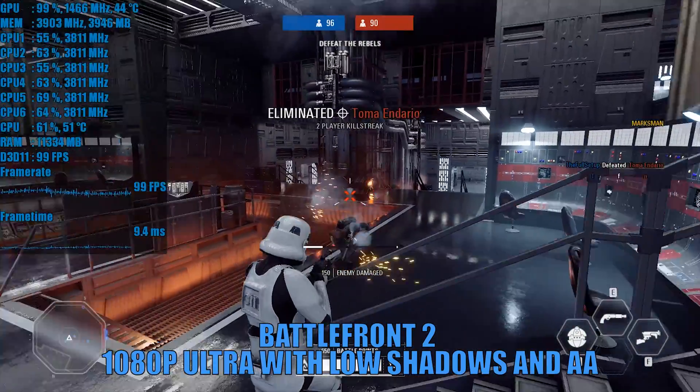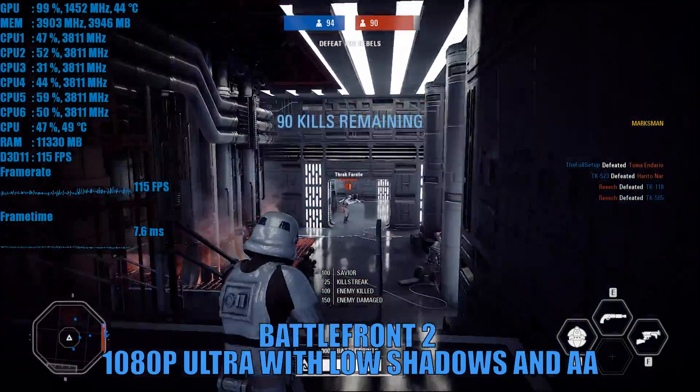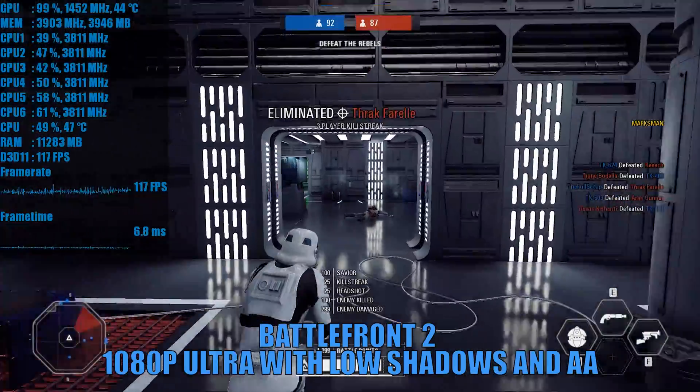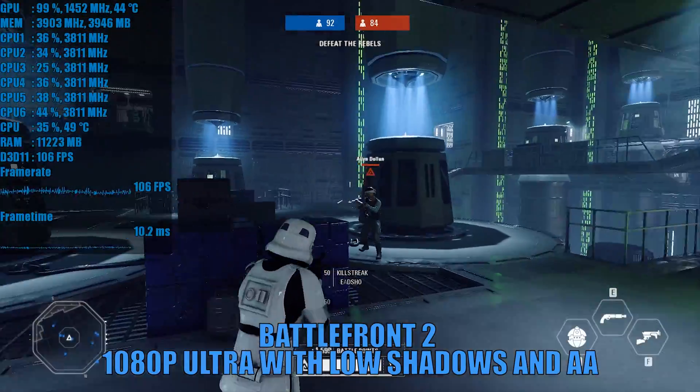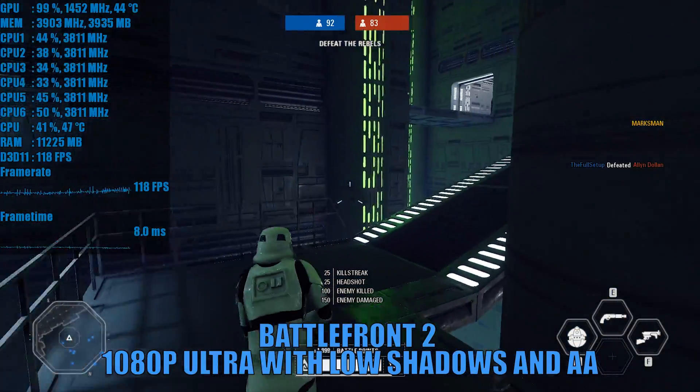There was something I ran into straight away: the EK Thermosphere doesn't cover the VRM on the GPU. That was getting hot at just stock settings because there's no airflow over it at all. As soon as I maxed the power limit out — no overclocking, just maxing power limit to stabilize clocks — the system crashed after about 20 minutes, it got so hot. What I did was stick a 90mm Cryo-Rig fan to the EK Thermosphere with a bit of Gorilla Glue on two corners. Since then I've been able to overclock 200MHz on the core and 400MHz on the memory, running the fan at only 600 RPM. If you're looking at a cheap universal block solution, you are going to need some sort of air on your VRM — even at stock settings.